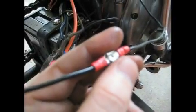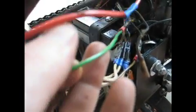One more time from a different angle. Regulator rectifier wires: white, white, white, green, brown, black, and red. The black wire comes from the regulator rectifier and goes directly into your negative or grounded terminal on your battery. The red comes from the regulator rectifier and goes straight through roughly a 10-amp fuse into your battery. The green wire from the regulator rectifier very simply goes into the green lead coming from the rotor stator assembly — that's one of your brushes.